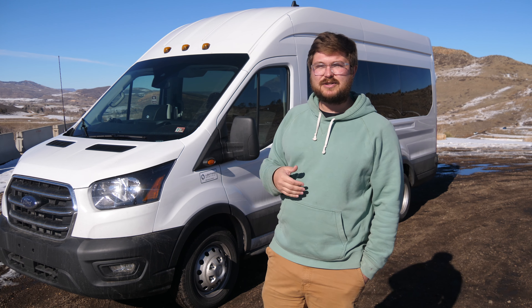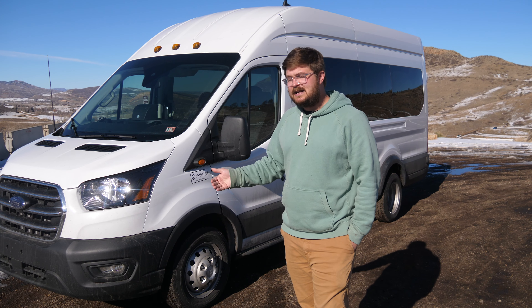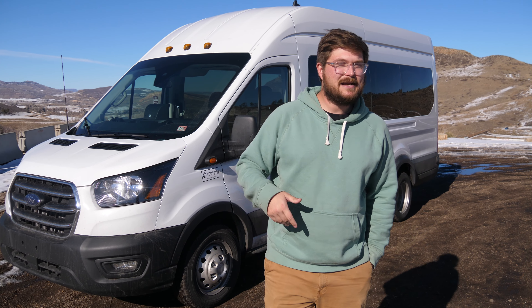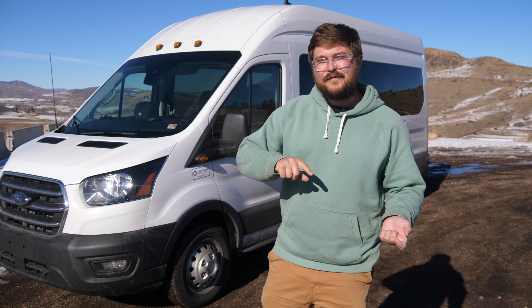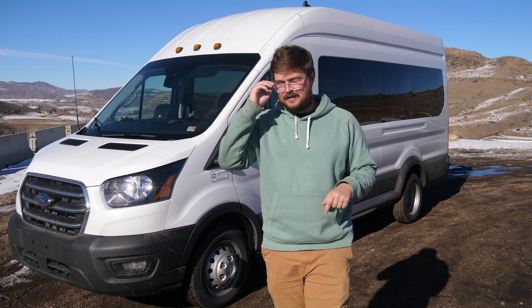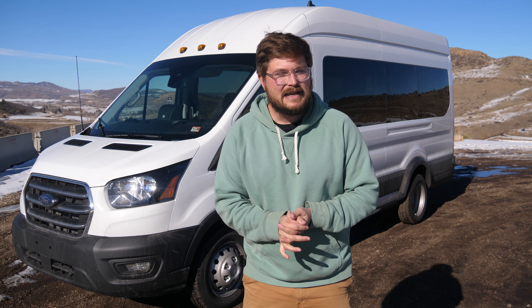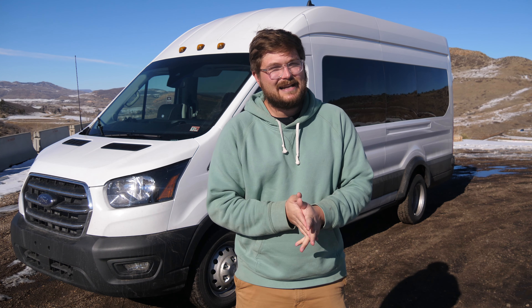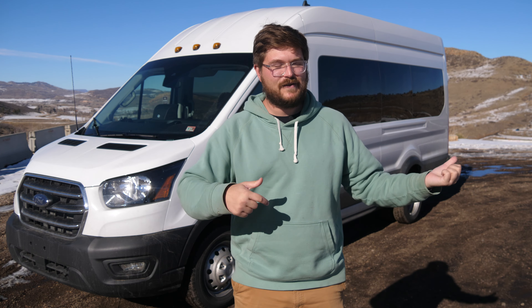For this week I've relied on AC charging. The peak AC charging speed is 6.6 kW — basically one onboard charger. In a future version of this van, they will have two 6.6 kW chargers, so 13 kW of AC charging coming soon. That makes sense given it's kind of needed with a battery pack this large in a vehicle this inefficient — though for the medium duty space, about 1.5 miles per kWh really isn't that bad.